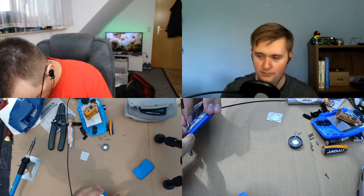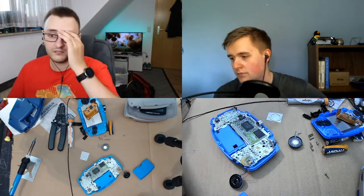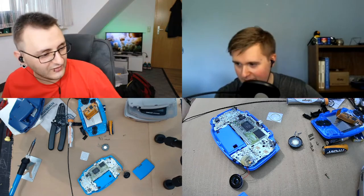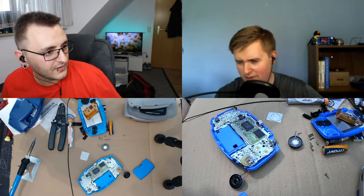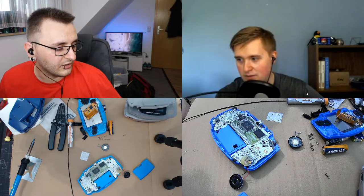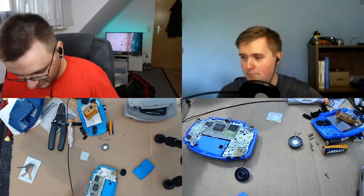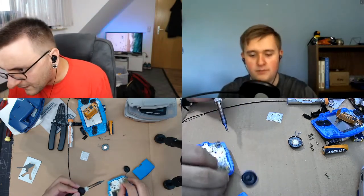The second cable goes to FL2 or SP? It's neither — I'm not talking about the one that goes to the cartridge port to ground. The second closest to the speaker goes up to a test point near the right of the board — it's not FL2 or SP, it's the right of SP. That's one of the soldering points of the speaker that was previously there, the upper one from my orientation. We could test this without adding the screen first, just to check if we have audio — it should boot without the display.